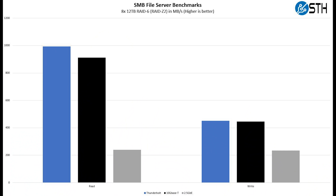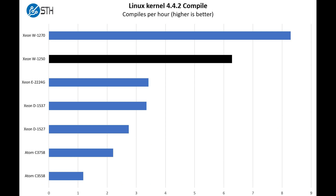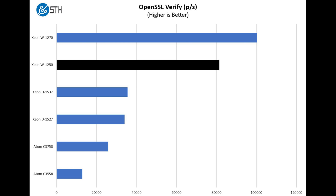Let's talk about performance real quick. We were definitely able to saturate the 10-gig ethernet port, and it seems like there's enough bandwidth to do that. On the two-and-a-half-gig ethernet ports, with a direct connection we were also able to get two-and-a-half-gig ethernet speeds — so you are able to pull basically port speeds on them. That does depend a bit on how you have the system set up, the type of access you're doing, and the capacity your arrays are at. But in general terms, yeah, you get pretty good performance. I also think that a system like this — if you're wishing for a 50-gig or 40-gig ethernet connection — I actually don't think the system would be fast enough to really handle that speed, so the 10-gig and two-and-a-half-gig actually make a lot of sense here.